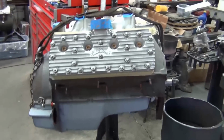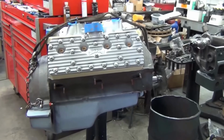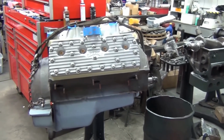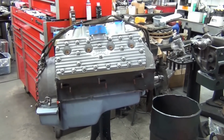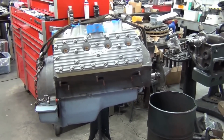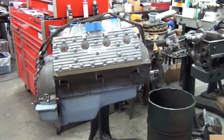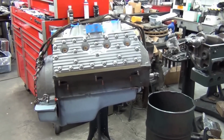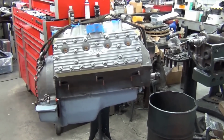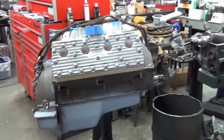And this looks familiar. It's an early flathead, 100 horse, 1947 vintage. This is also in a motorboat. That had a lot of work done, a lot of crack repair. Motorboat, okay. It needed sleeves. A chipmunk got into the cylinders and rotted them all out, so we had to put sleeves in. It's not uncommon, mice and chipmunks. Very common. They sneak right under the valve. All they need is an eighth of an inch. They squash right down, right?